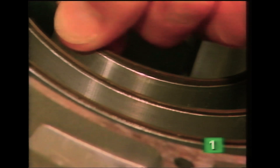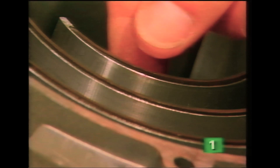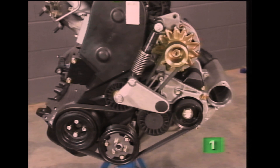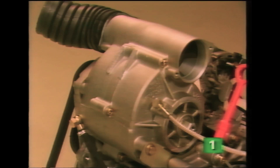Due to the low relative speed between the displacer and the housing — approximately 10,000 rpm — a long service life should be possible. The input, or drive shaft, of the G-charger is driven by the engine crankshaft via a multi-ribbed V-belt. The belt's tension is maintained by an automatic adjuster. The lubrication circuit for the supercharger is via a hose from the rear of the cylinder head and a return line to the sump.